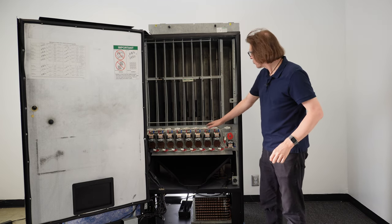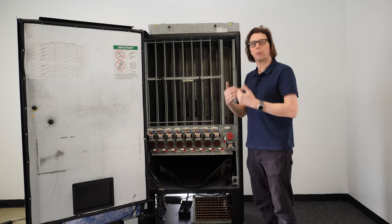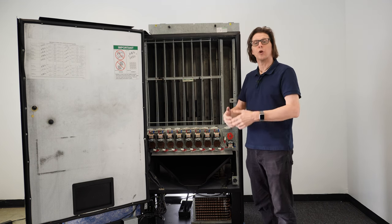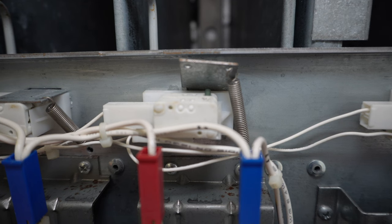When the switch is at rest — or when the sold-out paddle is pressing down on the switch when there's no product in it — the circuit is being broken. The computer board sees that broken circuit as no product, or off. In column two there's product and the sold-out paddle is lifting off of the micro switch.